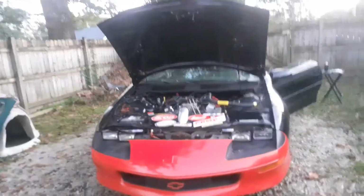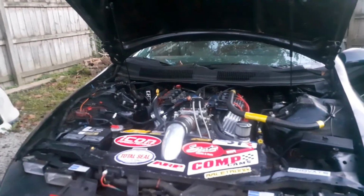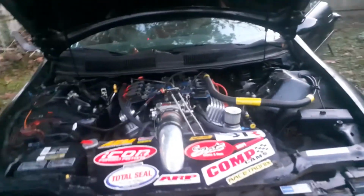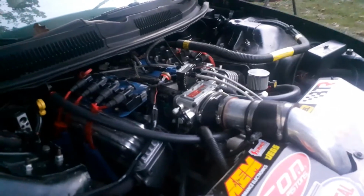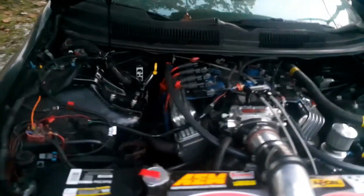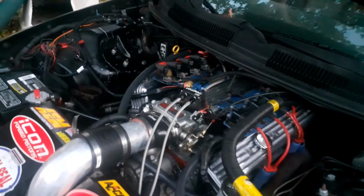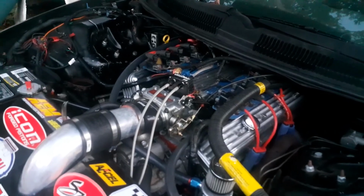But yeah, it's running good now. I mean, I hit the throttle and I was doing about 30 and I hit the throttle and it jumped clean sideways on me. So probably it was just the plug-in. It came loose a little, and that should have been the first thing I checked, and I didn't. I'm embarrassed to even tell y'all that maybe that was the problem, but it's running good now. Running real good now. A buddy of mine, Carl, said, wiggle your connector. I reached down there and went to wiggle it, and it pushed on a little bit.